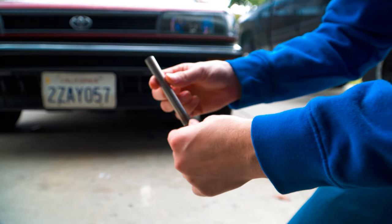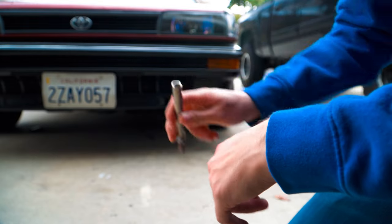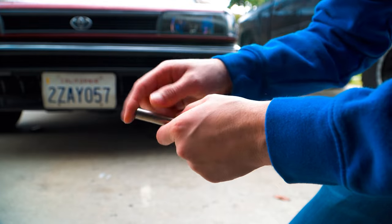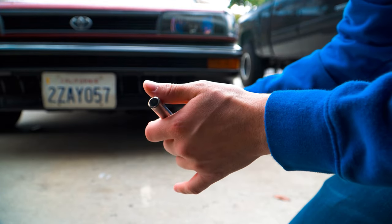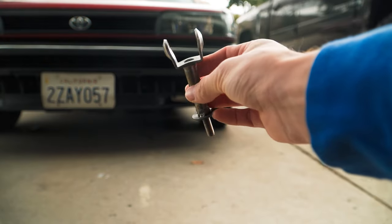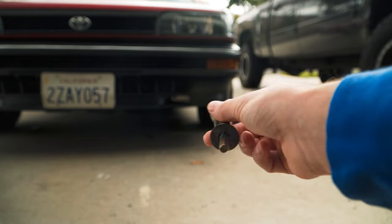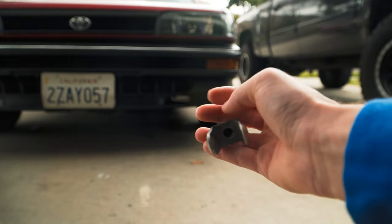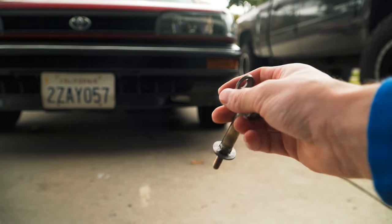There's a gap right here, so we're going to go ahead and finish welding all that part up. I've already welded a bolt onto just an extended piece of tube. I'm going to measure the length of that actually being bolted on, so then we can chop that piece down some, add that little U-bracket, and then weld that on. That should be pretty much set for this side and we'll do the exact same thing to the other side. The bracket bolts into the L-bracket we made for the car, and the fog light mounts like that — it's a nice little riser and we'll be able to adjust it.